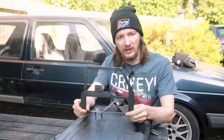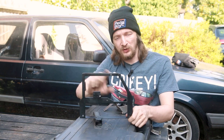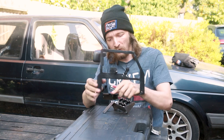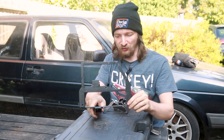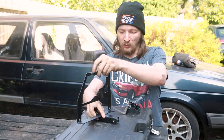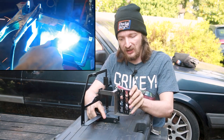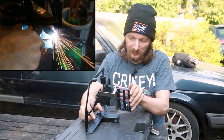Here's a quick rundown of the panel we made to hold the fuses and relays. The front face is lots of pieces of bar stock cut up and welded together into various shapes to conform to the little panels we had. There's a piece of 30mm box section that sits over the chassis with a bolt hole in the back, plus various tabs, spacers, and a stud to hold the relay panels. Looking at the back, a little connector panel welds on via a finger off the back, using a small arm to reach over the relay panel on the bottom.